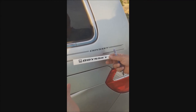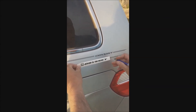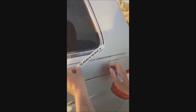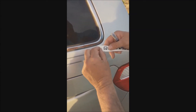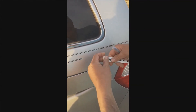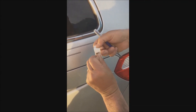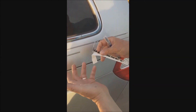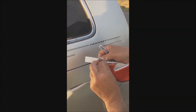This is Matt again, showing you how we put graphic decals on a stripe. You put the graphic up, leave the knife in place, swing the graphic up, make the cut, bring it back down, come over, pull the graphic without moving the blade, make the snip, take it out. Now I'm going to put this decal on — it comes on a carrier paper too. Sometimes it might not want to come up, so give it a good rub. Sometimes it's still being obstinate; press it to get it started on the carrier. Then it'll come off. Just work it a little with your thumb and get it started, then it'll come off.